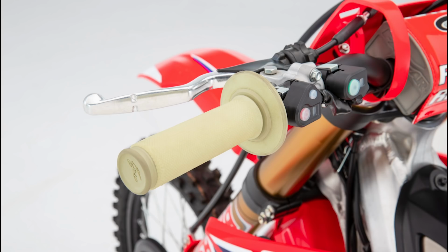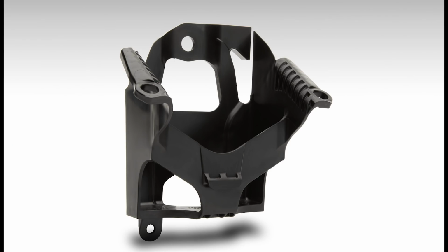This HSTC system actually has 3 modes of its own operation. So you're going to have your handlebar switch, that's your kill switch with the little blue dot that does the map, and then next to it's going to be another switch that looks similar to their old kill switch, which will run the HSTC system across 3 different maps for 3 different, as I say, conditions. So probably same thing. We'll have one that has a very minor intervention, one with a medium, and one with a heavy intervention system.